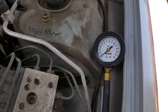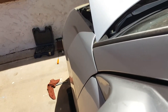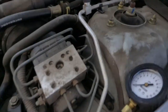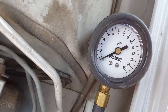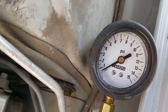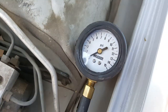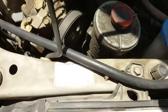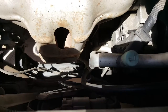I'm going to start the vehicle. In my first video, the needle went all the way to eight or nine while idling. Now you can see it bouncing back and forth a little — that's how it should go when you have a good, working catalytic converter that's not clogged. If I give it some gas, it doesn't even go out that high. So now you know how to check for a clogged catalytic converter — it goes right before the CAT.